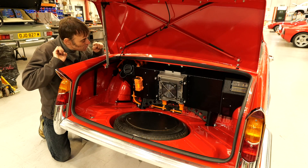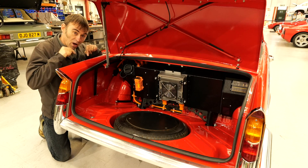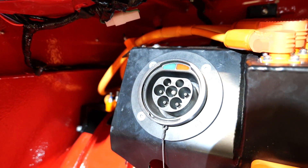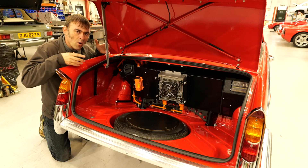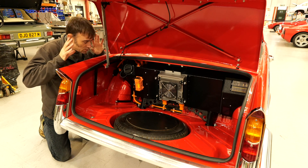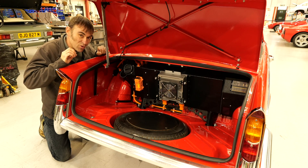The keen-eyed amongst you is probably wondering why I've put the charge socket in the boot. There's a simple answer: there's nowhere on the outside of the vehicle to put it. The old fuel filler hole was simply too small. So we put it in there. That's going to mean the boot has to be slightly open to charge overnight, but this car's owner is going to be using it primarily at home and not really doing long-distance journeys or charging in public anyway. And most importantly, that means we don't have to cut a bigger hole or grind out the original fuel filler hole to make it bigger — which is something I really don't want to do.